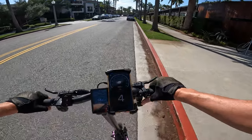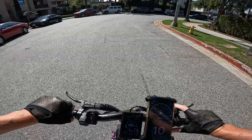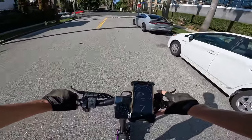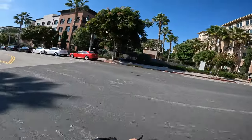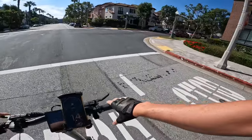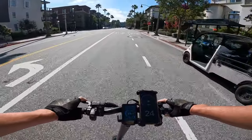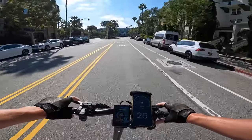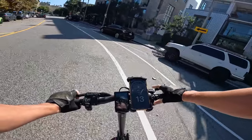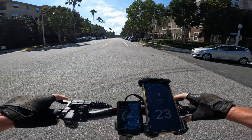Switching speed tracking to GPS on my phone. Mode 1 actually holds us at 8 mph — slower than eco mode, interesting. Mode 2 ramps on the power more gradually. I can already feel the steering damper making a difference. On mode 3 it feels stable and confidence-inspiring — already hitting 28 mph. Brakes are feeling nice, and I think there's a regen brake with about a one-second delay.